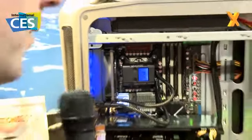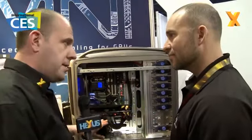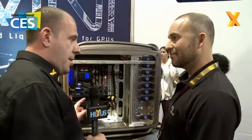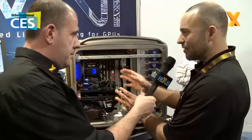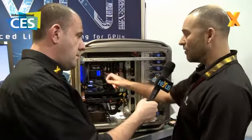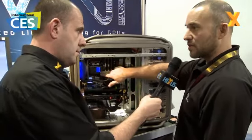So if you've got one of these newer compartmentalized cases where you might have a bottom zone to put your PSU, you could put the temperature sensor down there, and when that zone gets warm because the PSU is getting a bit toasted, you could have that trigger a fan — something like that. Absolutely. And since it is wireless, we can actually have that control node not be the only one, so you can add a second and have all of that fan information sent to this LCD module here.